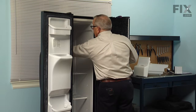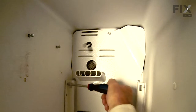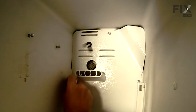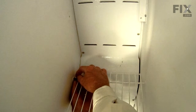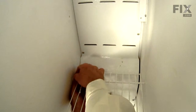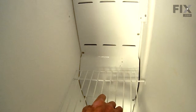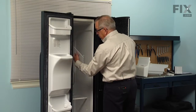Next we want to remove the left hand mounting bracket for that assembly. It's held in place with four screws — remove those and set the bracket aside. Next we'll remove the uppermost wire rack, so remove the little rack stop first. Then slide the rack to the left, lifting up on it so that it clears the bypass, then tilt it up on the right and pull it out.